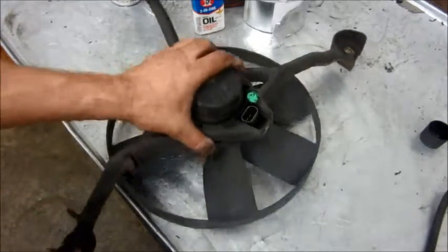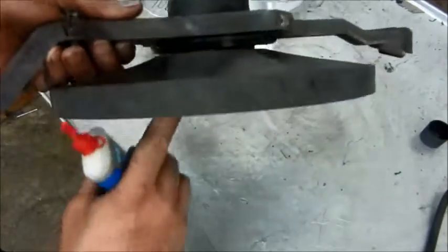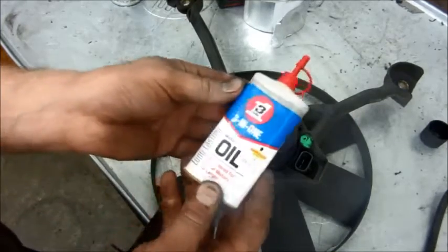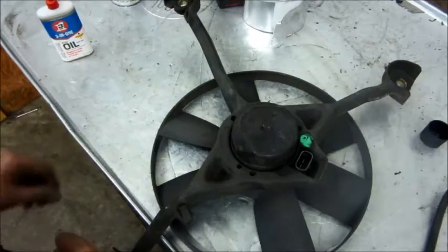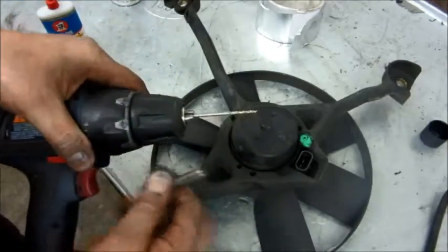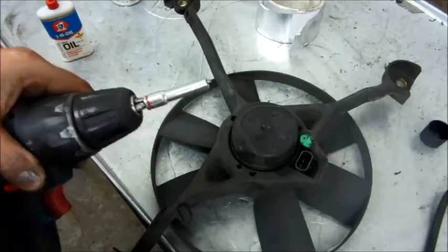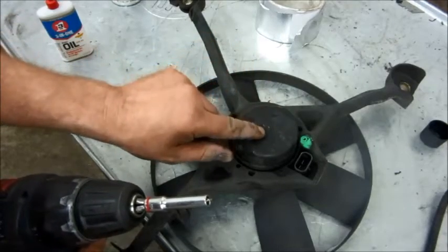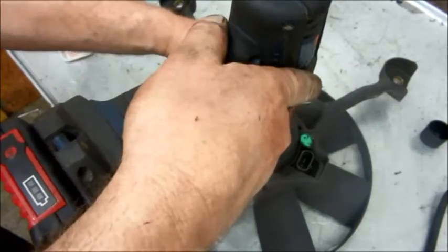I got this auxiliary fan from the junkyard. I don't know how many miles the car had on it, but the motor still sounds very smooth. I want to oil it before I put it in the car. The front bearing behind the fan is a ball bearing — there's really nothing you can do with it — but in the back it has a bushing with felt for the oil, and electric motor oil is the ideal thing for it. To get access to that I'm going to have to drill a hole back here. I'll take a small bit and put a socket over it as a spacer so it can only drill that deep — there's no way I can drill into the motor and damage it. The area I'm going to drill is between those four tabs and the bearing, because that's where the felt is. The width of that socket is just about right.